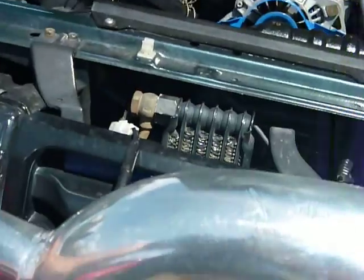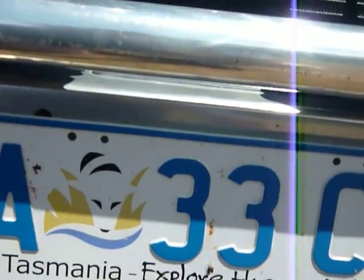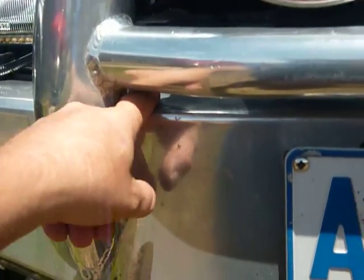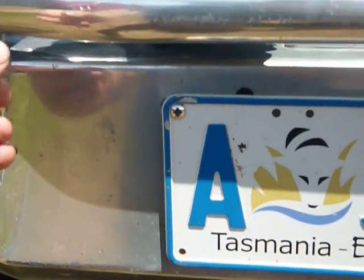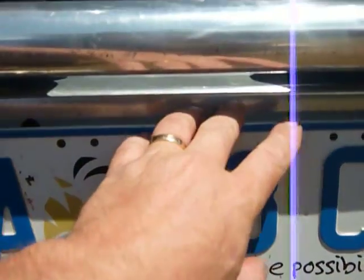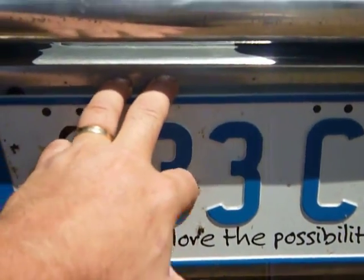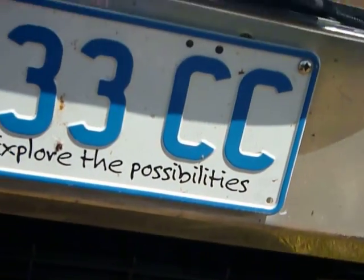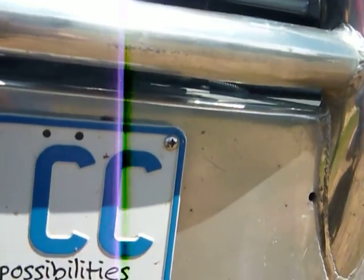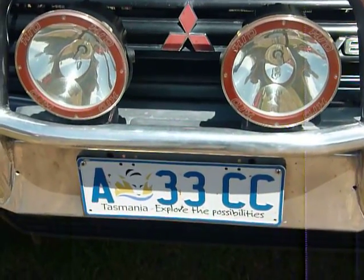Why that's bent at 90 degrees is because under my bar here, I'm putting it underneath the light bar, and it's bent at 90 degrees to go back in under behind there. That way, once the winch is in, like I said, it's still going to point down to the ground, but it'll be showing where my winch cable and that is, so I can unravel it and unhook it. But I need to clean the bar down with a bit of Scotch Brite and a bit of metho before I apply the thing. Okay, all done.